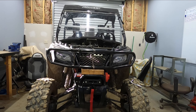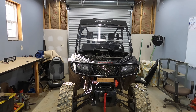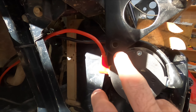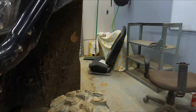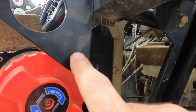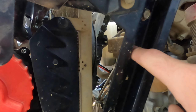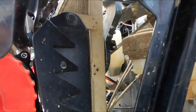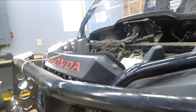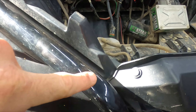So here is kind of what I'm thinking as far as placement. We're a little crooked — I just have that on a block for now — but I think that will work pretty good for a brush guard. Now for the bottom here, I don't think it's going to be too bad. We have a hole right here. If you look here in the frame on both sides, there's a hole right here. So I think just a simple bracket from here to here — two bolts will fix this up on the bottom.